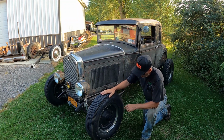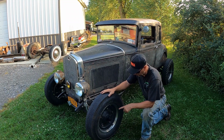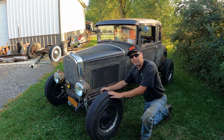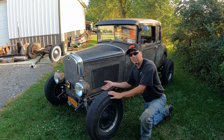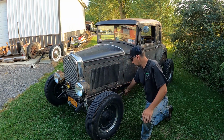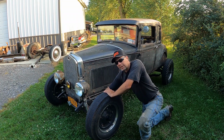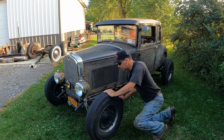I have on here 1938 Ford wide 5 wheels, 16x4s all the way around, with '38 Ford front wide 5 drum brakes. The front axle is a 1936 Ford half-ton truck or car, same thing. Axle, it actually came out of a pickup truck, but the same as a car. I've got the split front Ford wishbones, and I'm actually using the front spring mount that would have been on the stock '36 axle I'm using for a shock mount. Haven't seen too many people do that.